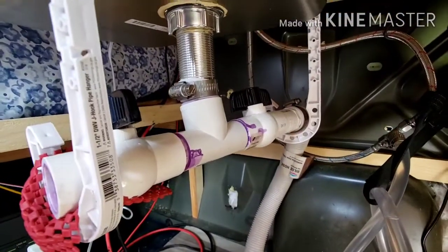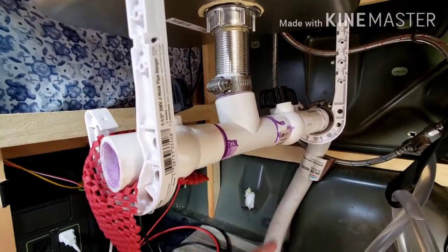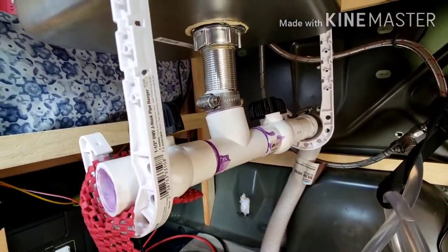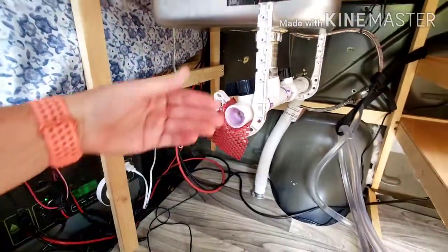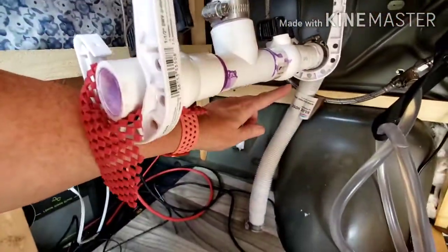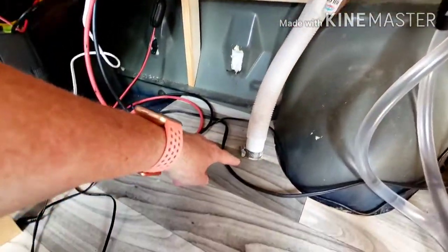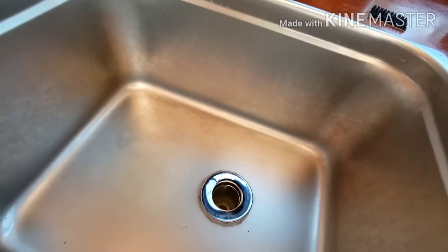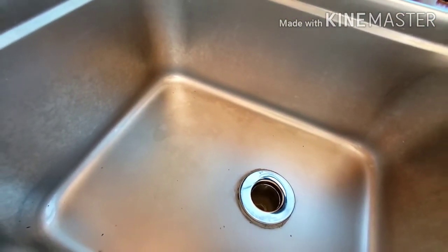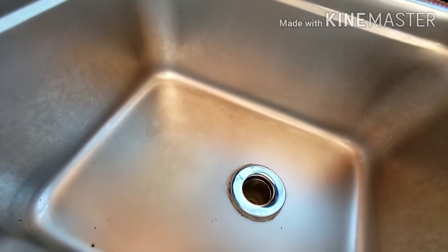So the plumbing is probably the most difficult part. At first we wanted a gray tank and I also wanted it to go down through the floor of the van, so we put a valve in to do that. But it turns out the gray tank just took up so much space and the plumbing ended up coming out too far, so we don't even use those valves. The gray water just goes straight down underneath the van. This is just a plastic RV drain, and the stuff you use to put in drains ended up leaking, so we just use butyl tape and that has been working great.